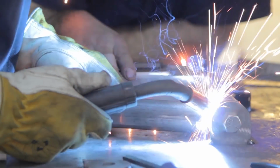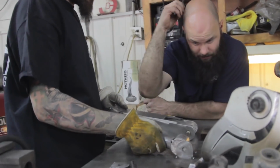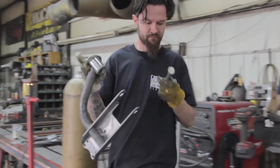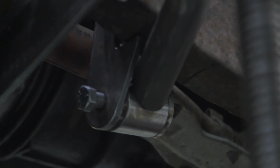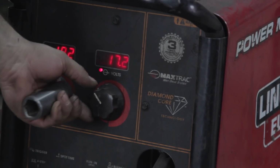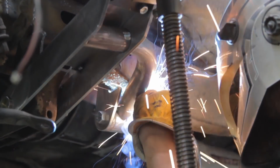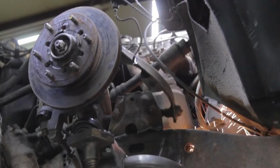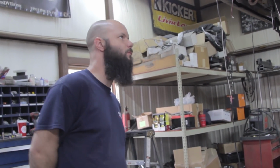All right, we're wrapping up another Mini Truck Sunday here. We've got the whole day consumed with R&D on Kyle's front suspension. We've got the lower control arm built. We've cycled everything once or twice and got everything pretty close to figured out. Sean actually cut the inner fender out, and we were able to cycle it with a wheel and tire to get it to lay frame on the 18s with the bigger tires. So we're not 100% done. We still got to grind down where the bump stops and we'll clean all this up, cap all this in, make it look real nice.